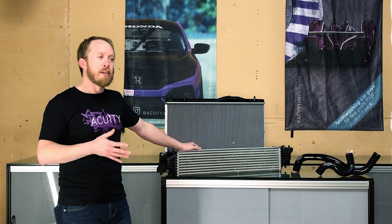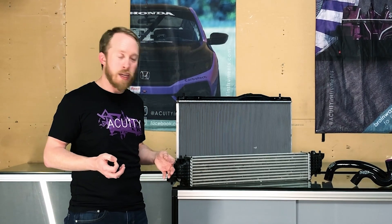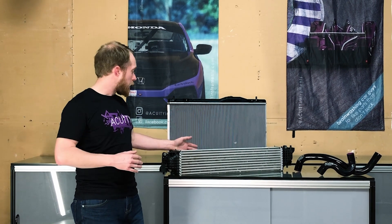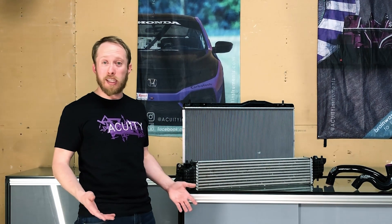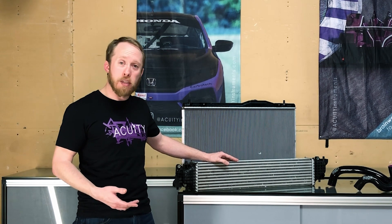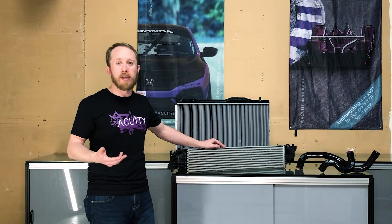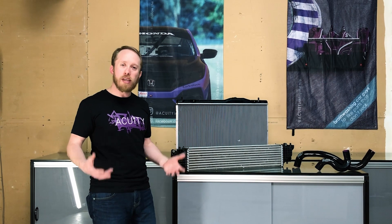You're probably thinking — what about the condenser? The condenser works a bit differently because it uses refrigerant, giving it a more uniform thermal profile, which actually helps average out the temperature profile passing through it. But there's still a thermal gradient that can negatively impact the radiator. What's interesting is that the air entering the radiator at the bottom is actually very close in temperature to the water leaving the radiator. Because the temperatures are so close, the bottom of the radiator barely cools your car. In extreme conditions, when the intercooler is rejecting a lot of heat, the bottom of the radiator can actually heat the water before it returns to the engine — meaning the top half is cooling water while the bottom half is slightly heating it, or doing nothing at all. That's obviously not what you want from your radiator.